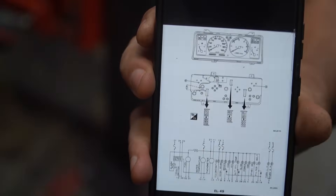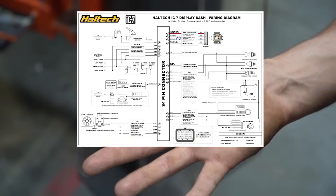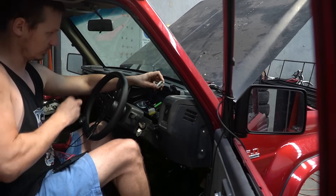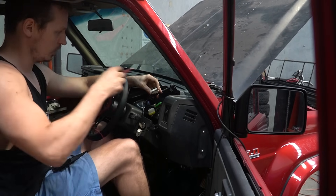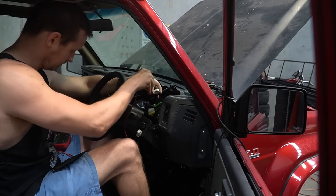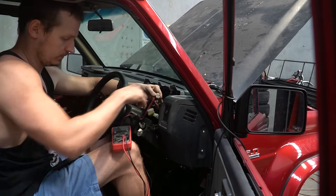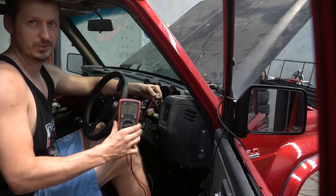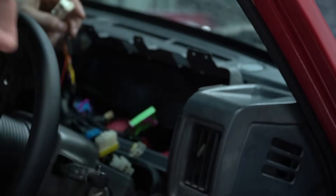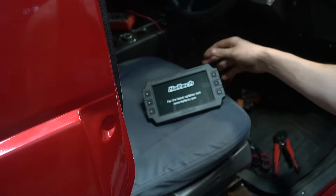So maybe I'll put this as an overlay — that's the diagram for the GQ dash, and that'll be paired to this wiring diagram. I'm going to start with switched power, which should be this bottom right-hand pin. And obviously you can't always trust wiring diagrams. Should be no power now — it's 12 volts. Why are you 12 volts? That currently says zero volts. When I turn the key on, now it says 11.6 volts. My battery's a bit low. So with that one wire, this should work when plugged in. Probably going to blow up.